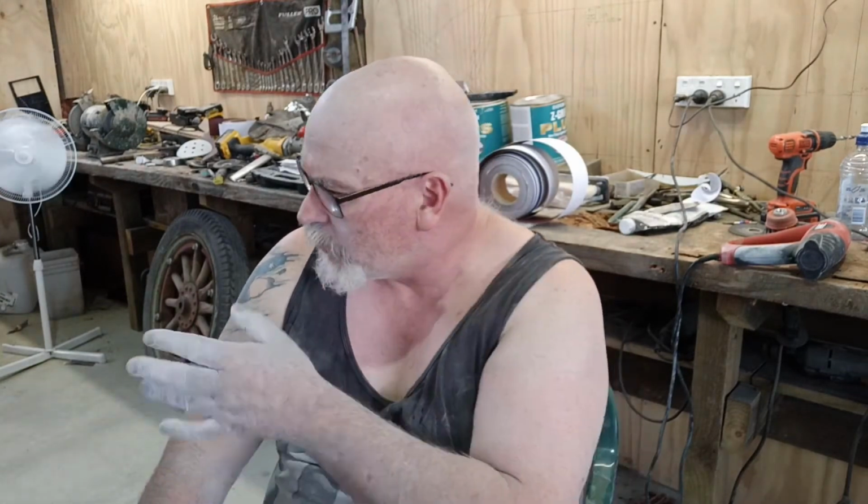Oh well, yeah, I'm stuffed. Blocking takes it out of you, especially when you're doing it all by hand. Basically not using a DA or anything like that, just doing it all by hand with my blocks, and a little bit of hand sanding just for the odd little funny area, but yeah, I'm pretty beat. It's just after 4 o'clock, but I've block sanded three panels really, and done one again with some glazing putty in, bits and pieces, and knocked it down a bit harder.